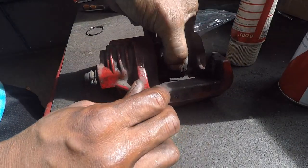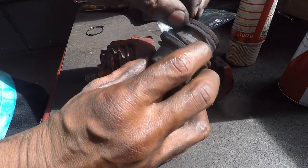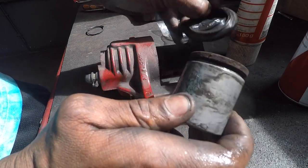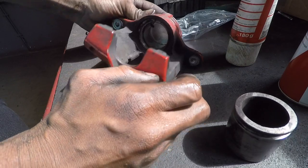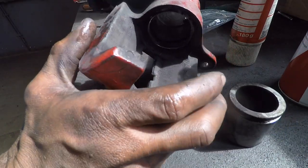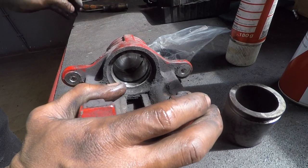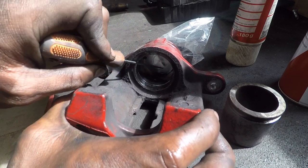You can see all that dust — this is your piston. As you can see, my dust boots were pretty worn from all the heat and abuse, so we're going to go ahead and remove that dust boot right now. With the piston set aside, if you look inside the caliper you may be able to see there's a seal in there. Now we're going to take a small flathead screwdriver to get that seal out of its groove.